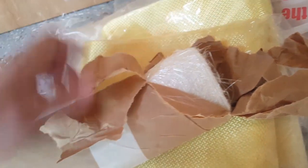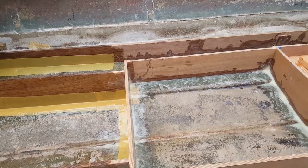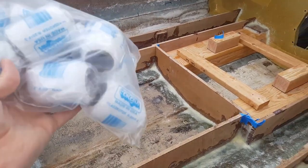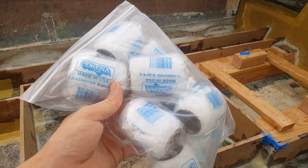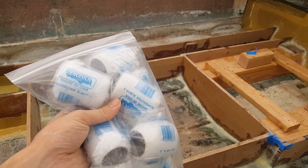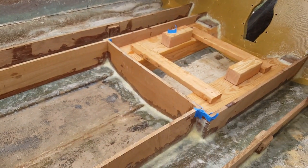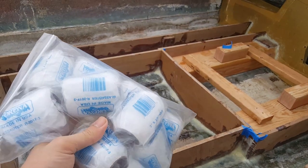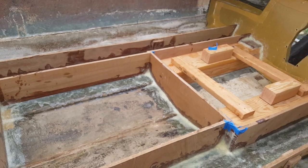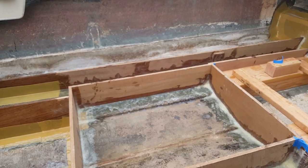Some stringers still need to be coated because all the wood in here needs some sort of sealant. I'm using glass coaters from US Composites — basically you get a painters tray full of mixed epoxy resin, or polyester if you're just coating wood for sealant purposes, and you take these coaters and brush along the edges and the top. You want to make sure you seal all the wood in here because moisture gets all over the place and you want to give your wood a fighting chance.